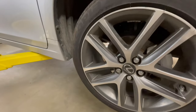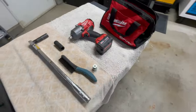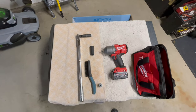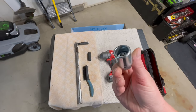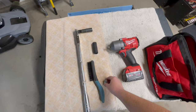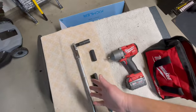Let's talk about a couple of tools that you need for the job. First things first, you need the wheel lock — you gotta make sure you got this or else we're not taking the wheels off. There are ways to break them off, but we'll assume that everybody has not lost one of these. It's usually in the glove box or where the spare tire is in the trunk. Next thing: a 21 millimeter lug wrench — this is for the wheel lock plus the regular four lugs on the car. I've got two because I'm gonna leave one on the torque wrench.